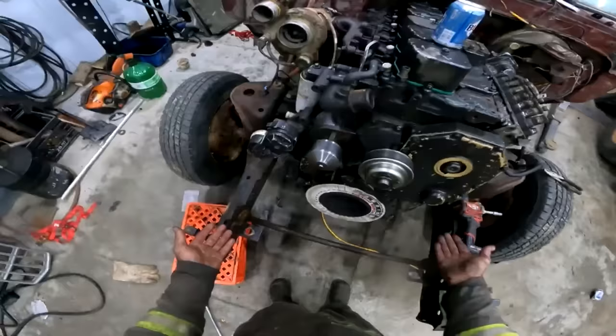There, so that's her. So what happened is the engine moved, the pump gear didn't, or the pump gear did, but the shaft didn't. So now we just advanced the timing 8.5-ish degrees. So now she's gonna rev to the moon.